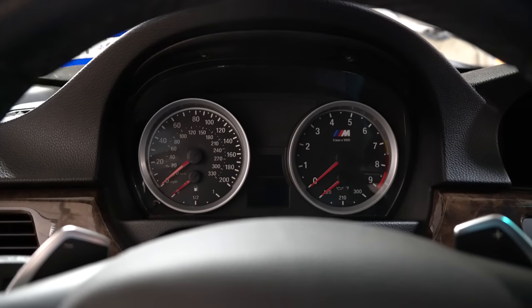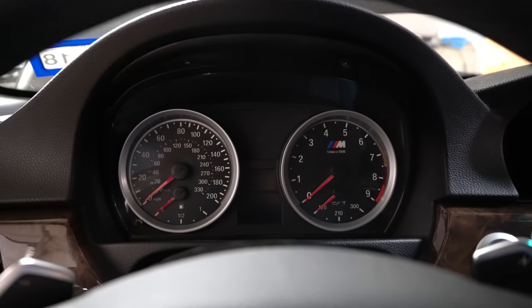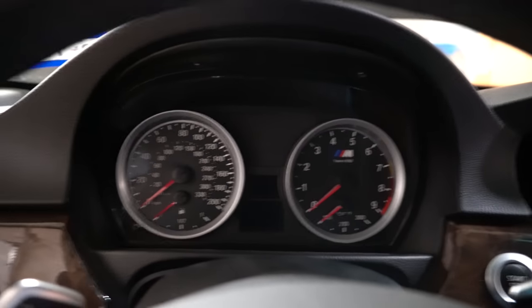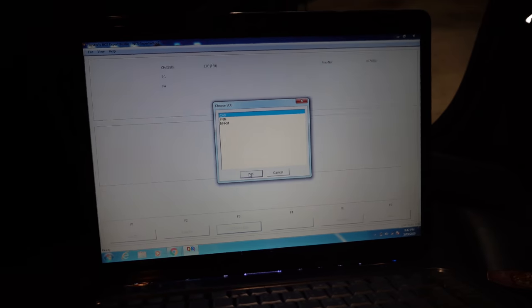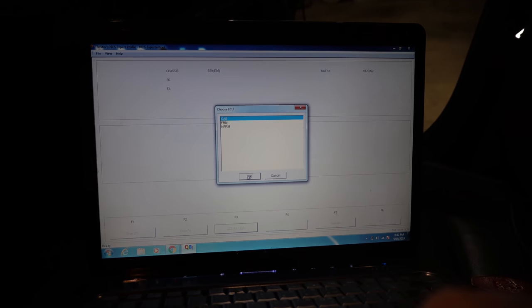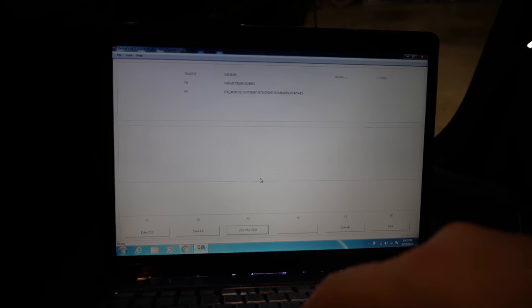So I'm not going to be screen capturing for this because I want to be able to show the gauges. But to get the coding accomplished we're going to use a piece of software called Perfect Toolbox, made by a guy named Mr. Perfect with a K. Pretty cool that he made this software. First thing I want to do though is key on and download the combi file. To be able to use this software you're going to have to set up your laptop to work with INPA or the usual software suite - I'll put a link in the description. So for it to work this has to be set up and then you can go ahead and install the Perfect Toolbox software.